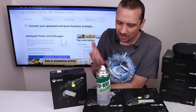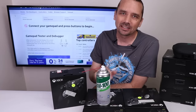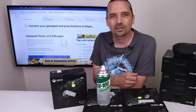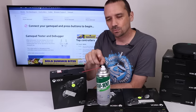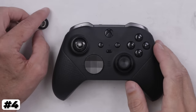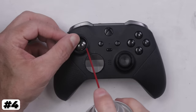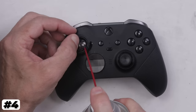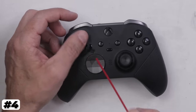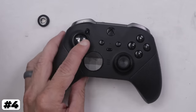BW100 is a great electronics cleaner, especially for things like controller analog sticks, because it can get right down into where the dirt and grime is and wash it out, then it evaporates very quickly leaving no residue. Another favorite thing about BW100 is that it is non-flammable, so you can use it for basically any electronics with no danger to yourself or the device. What I'm going to do is move the stick over until we can see a little gap, spray some BW100 in there, move it all around. This may not be enough to get the BW100 down inside without taking the top cover off, so most likely I'll need to remove it, but I want to try this first.